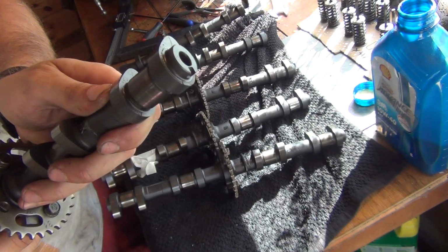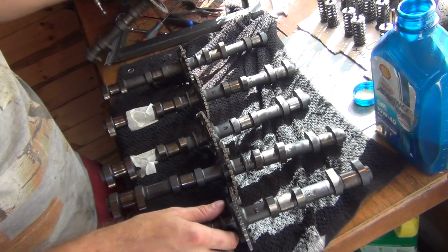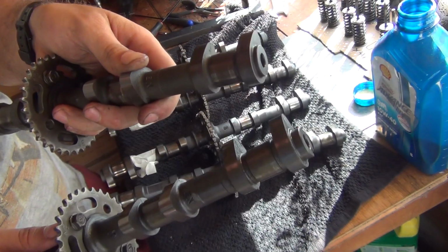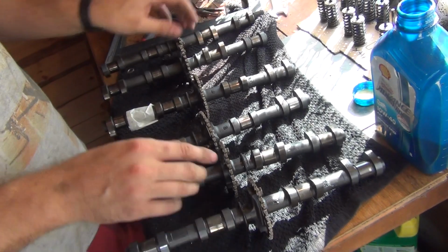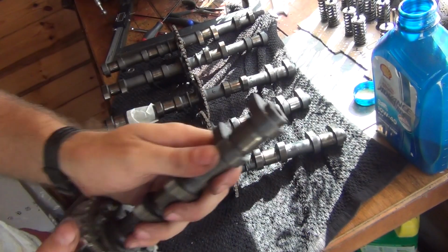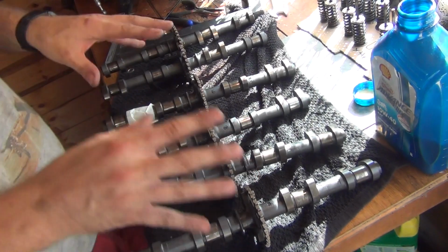That is sticking out by about 6 millimeters, half a centimeter, whereas the RF900 has a very little lip sticking out here. So compare this, you see? So if you wanted to install the 1100 or the 750 in the cylinder head from the 900, you would have to shave that, which I've done in my other RF900 engine. So that will definitely work.